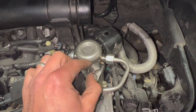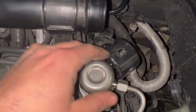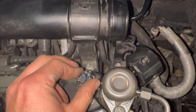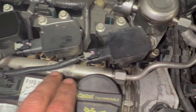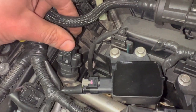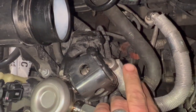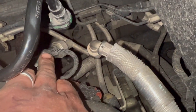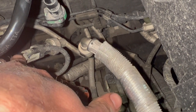When the high pressure pump fails it normally won't run at all, and if you take it out and compare it to your old one you'll find the spring is normally sat in a little bit further. The pump is really easy to change — there's a push-crimp fitting on the supply-in pipe underneath the cover, a three-pin connector, and just two bolts to hold it in. Coming down from there on the high pressure side you've got the fuel rail and the high pressure sensor screwed into the rail with another three-pin connector. The sensor we're replacing is on the low pressure side — follow the pipe down and it's screwed into the pipe itself, with a three-wire connector on it.